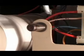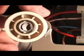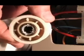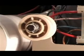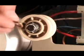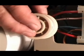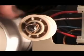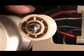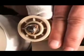Apply some of the heat-resistant grease on the shaft and on the wheel. Install the wheel and install the plastic triangular stop ring. Set it in place, push down until it snaps on. Clean the idle pulley wheel. Make sure there's no grease on it.